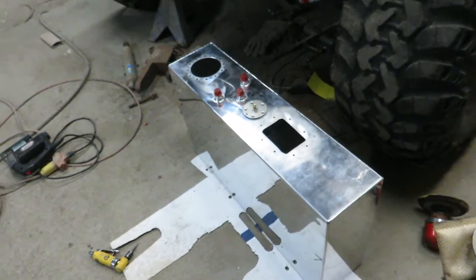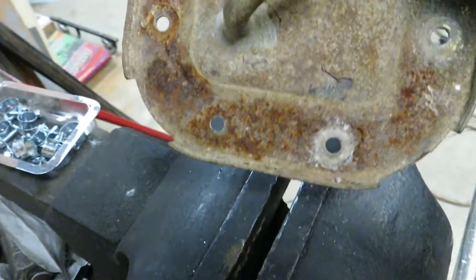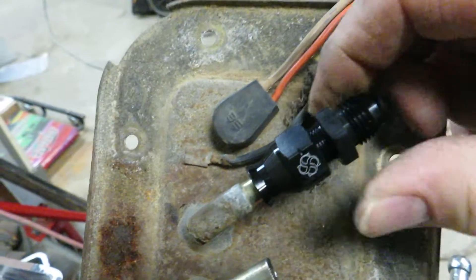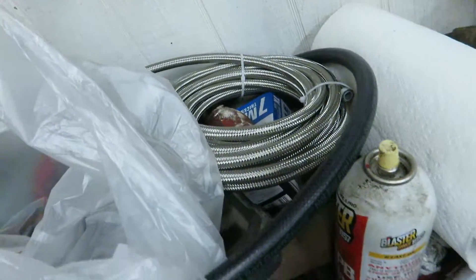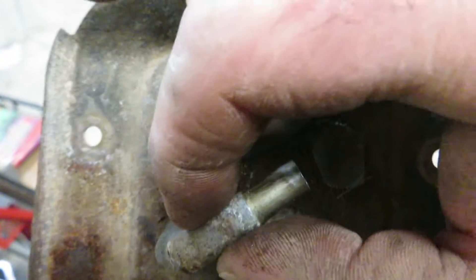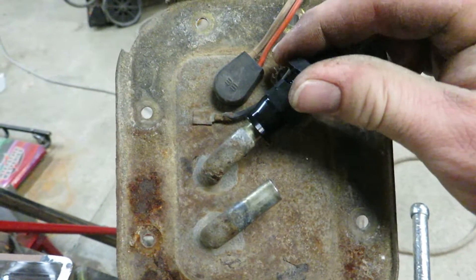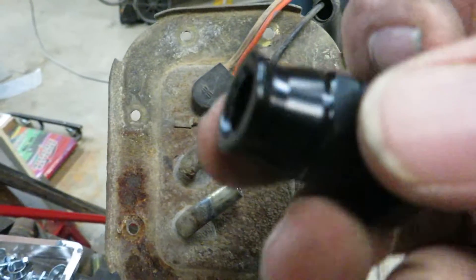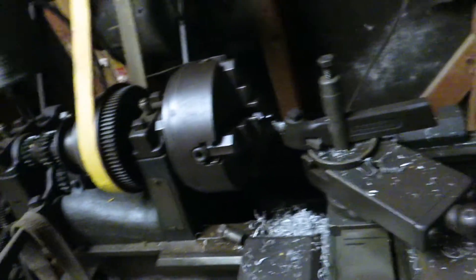The sending unit had these little barbs for rubber hose, so I chopped those off. I got some compression fittings to convert to dash-6 AN — I'll use Teflon line all the way up to the motor. The return side is five-sixteenths, which necks down from three-eighths up top. I can't get my fitting on there far enough for the ferrule to attach and still get the line all the way in, so I'm actually gonna have to turn this fitting down on the lathe — kind of ridiculous, but that's what I'm doing.